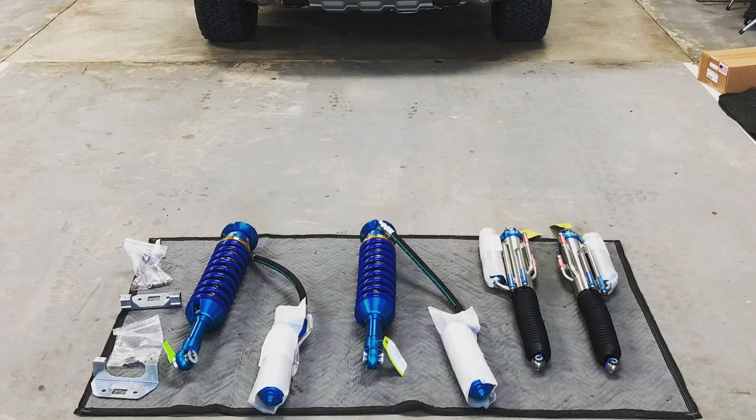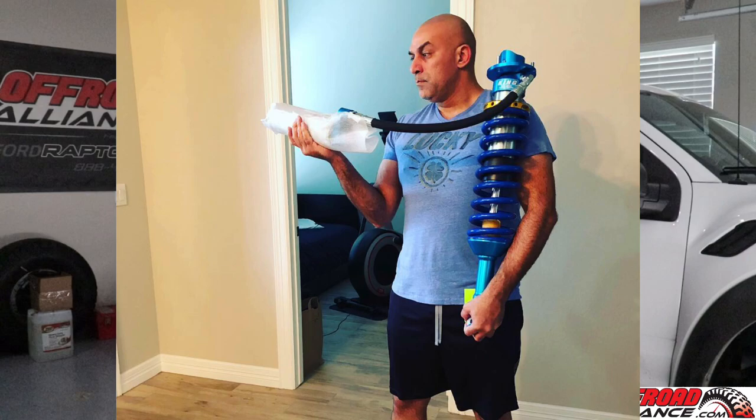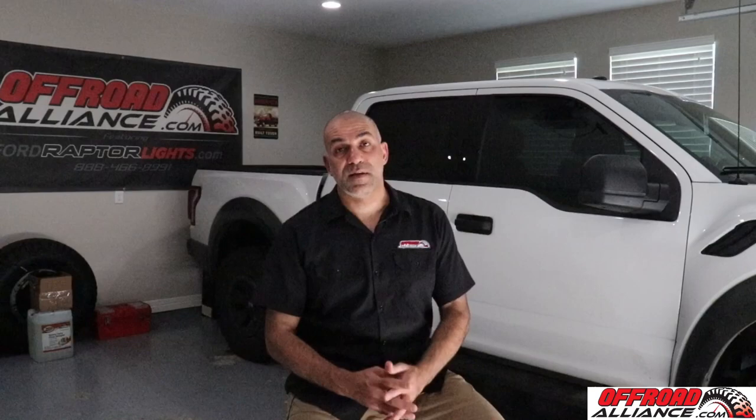When I started looking and researching options for modifying the suspension on the truck, I realized it's best to just replace all of it. This suspension comprises your upper and lower control arms, a coilover setup in the front, rear springs, and shocks. What I ended up doing to start was replacing the front coilovers and the rear shocks first with some custom-tuned King 3.0s.